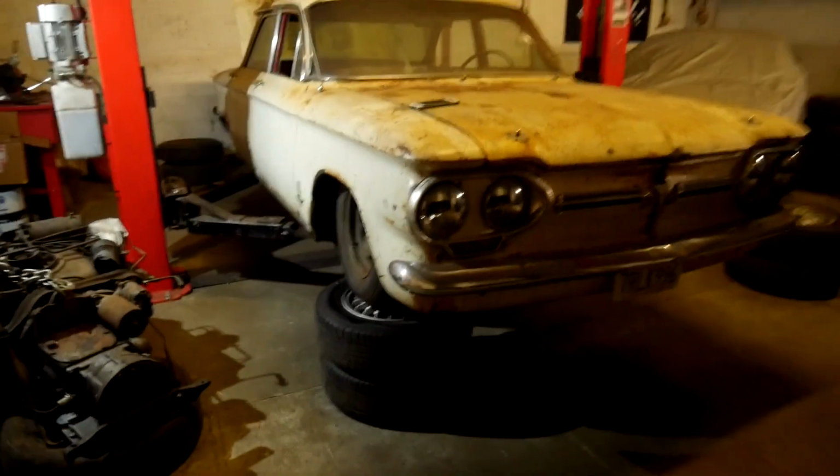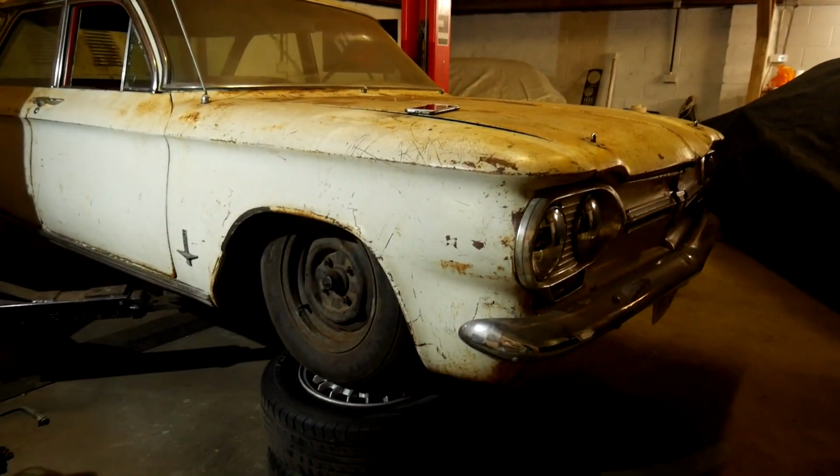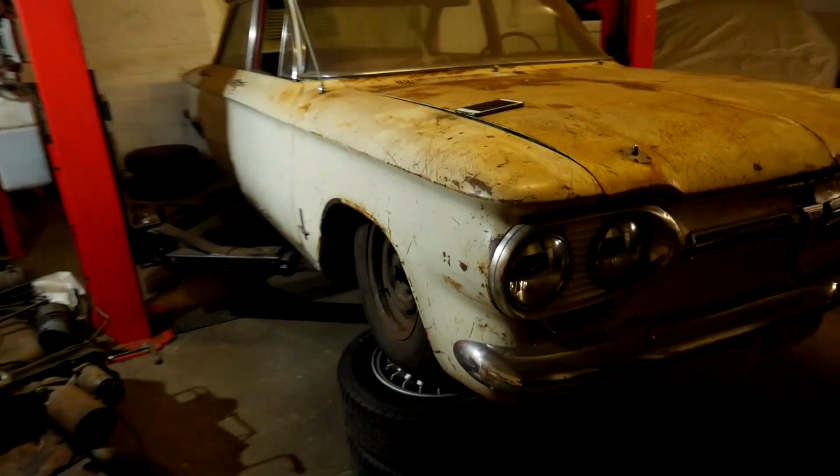I may get a little bit more out of it by shaving something, but yeah, it's pretty serious for the front. The bag doesn't seem to be catching or fouling on anything, so that's good. All the arms look like they're in the right place, so just got to get the control arm for the other side, get the tension rods for the front, and then we can pretty much button the front end up, which is sick. I'm really happy about that.